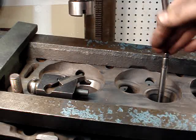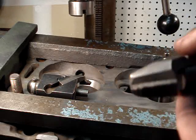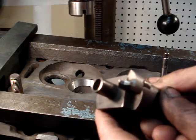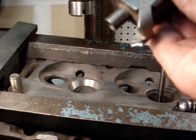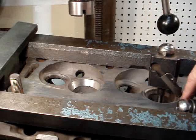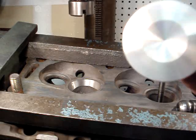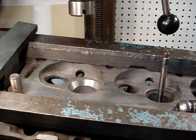We went ahead and leveled this up to the head — it's perfectly leveled right now. This tool is what we call a bull hog, and this is going to go in and we're going to cut the throat. This tool here has multiple angles on it — it's a three-angle cutter. That's going to go in on our pilot here, and as we run this down, it's going to cut our throat to the right size. We've set the 45 degree angle on this cutter, which is right about in the middle, to our valve seat. We have a fixture with a pointer on it that sets that up. So we've got this set for the exact valve size.